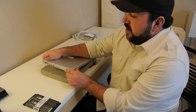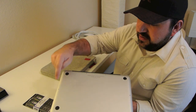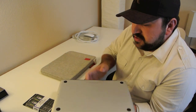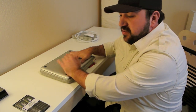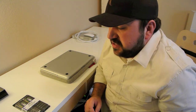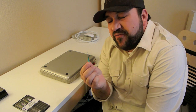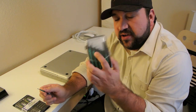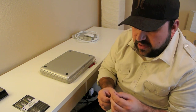The first thing we're going to do: on the back of the MacBook Pro you have 10 little screws, and all you need to do is unscrew those. You want to make sure and touch something metal to get rid of that static electricity. It is a 1.4-millimeter Phillips head screwdriver — very, very small. I got this set at Radio Shack for about $10, or you can probably find one online for a lot cheaper.